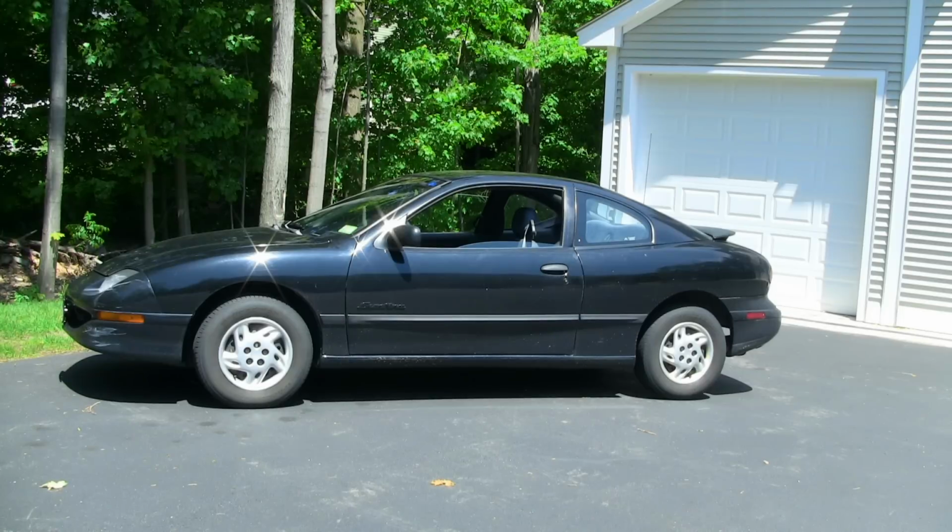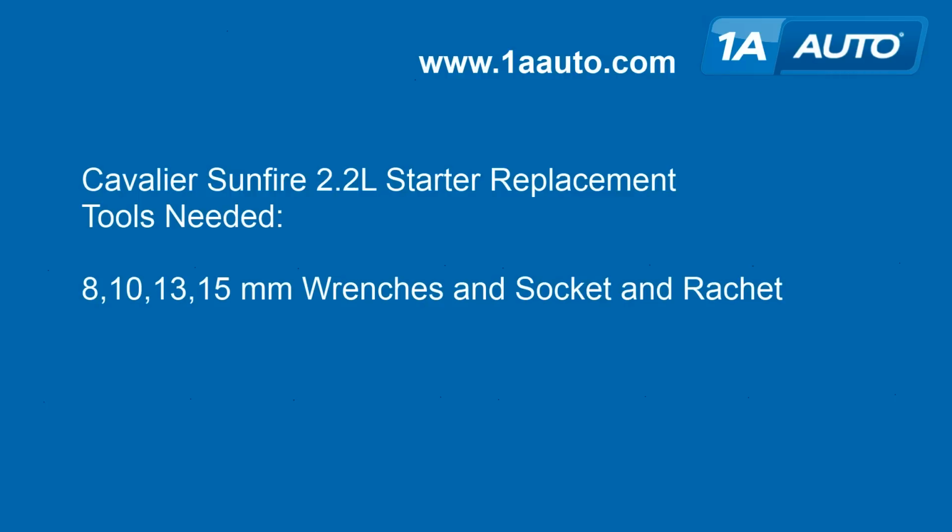In this video, we'll be showing you how to replace a starter in this 1997 Pontiac Sunfire with a 2.2 liter. This is the same for many 95 to 05 Cavaliers and Sunfires with the starter that bolts from the bottom rather than from the back of the engine. Tools you'll need are pretty much just some basic 8 to 15 millimeter wrenches and socket and ratchet with various extensions to get in and out of the places you need to get to.